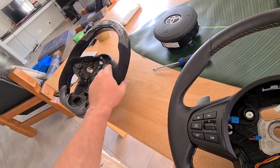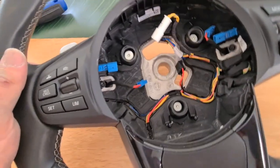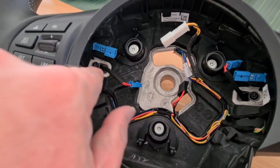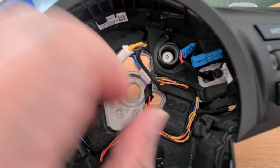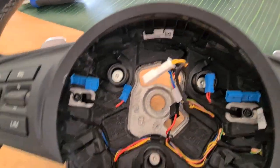We're here on the workspace. Here's the carbon fiber wheel and here's the airbag horn complete with the whole clock spring assembly. In order to start getting everything off, we're going to take off the paddle shifters first - these Torx bits down here. These blue connectors unplug exactly the same as the white one we unplugged earlier - depress down inside that hole and pull it out at the same time. Once we've done that, we can undo the Torx bits and remove the paddle shifters.